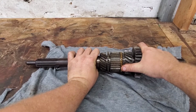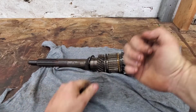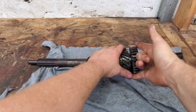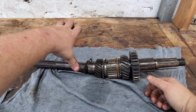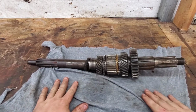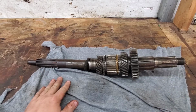If for some reason you can't put the transmission in first gear, or you're not comfortable doing that, pull your top cover off, remove your shifter, and some people will either bungee cord the shift forks or actually put the sliding gear and anchor it with a bungee cord to something. So just a quick tip, because that happened to me, unfortunately, the first time I ever took one of these transfer cases off years ago, and it was a lesson I never forgot.